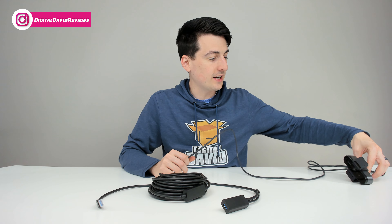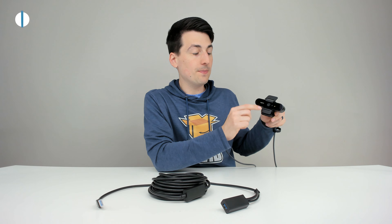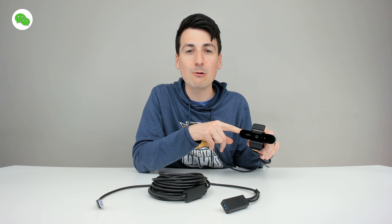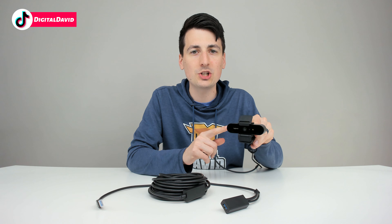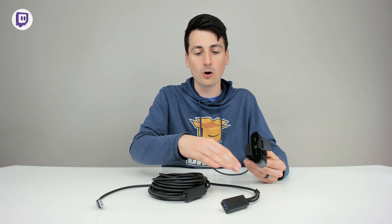Now let's go ahead and set it up. For today's test, we're gonna be using a Logitech Brio web camera to see if it will be able to work using this cable. If you don't know anything about the Logitech Brio, it can work with any cable up to 1920 by 1080p resolution, but for 4K resolutions you have to have a USB 3.0 cable in order to get those faster transfer speeds. It's really picky on which cables it will work with, which is why I discovered the Ugreen 15 foot extension cable a couple of months back.